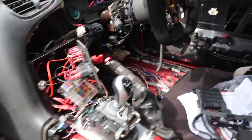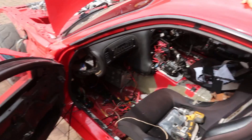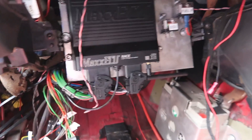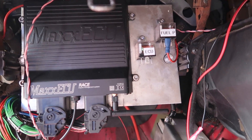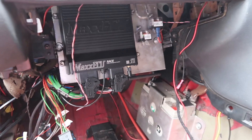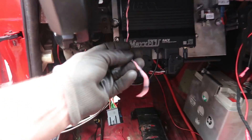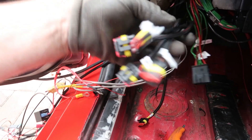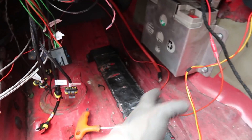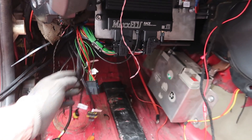The actual chassis wiring over there is going to need a bit of work and same with this as well. So it was just basically a lot of quick stuff to try and get things going, so now I can go back over it all and take a wee bit more time. I've just got the two relays up here - one for fuel pump, one for ECU - because the fans are now actually controlled PWM. So they'll just get a feed direct to them and then I'll use these outputs here to control fan speed. I haven't got too much here to connect up - CAN bus, launches and speed and cruise control inputs and stuff like that. The biggest one is probably going to be the pedal position sensors and main ECU power, so I'll just hook that off of here and take the main powers from here.